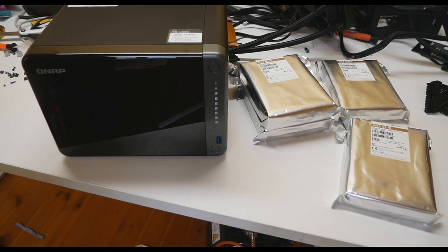I don't want anything overkill. I wouldn't build a NAS from very powerful components if there's absolutely no need, because I want this thing to draw as little power as possible. I think a device with four to six hard drives should consume only around 30 watts or so — that's not much at all. For me it's only about storing data: travel videos, overclocking videos, operating system images, and so on. I won't be loading programs from this device, so I don't need the utmost speed, but I don't want anything too slow either.